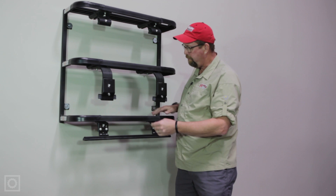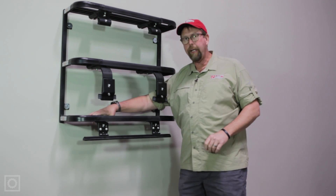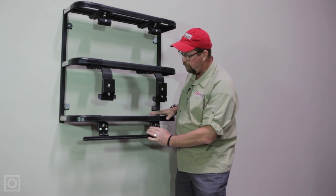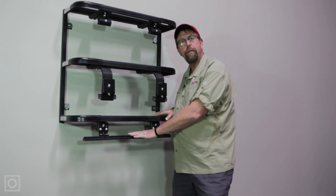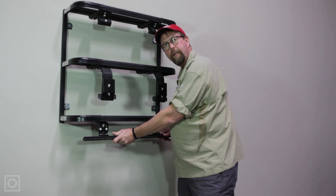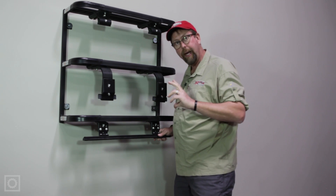On the bottom of every one of the racks are what we call the cross braces, and the cross braces run left to right across the vehicle. They have a T-slot in the bottom — a semi-elliptical design with a T-slot that allows us to attach what we call feet. We have a K9 roof rack foot that mounts into our mounting rail. The mounting rail is designed to attach to the top of a roof in the factory roof rack mounting points. The feet come in 40mm, 65mm, 80mm, and 90mm height, so we have some height adjustability there.